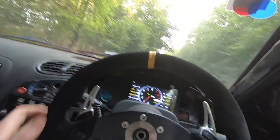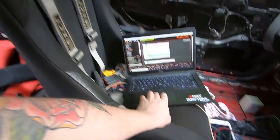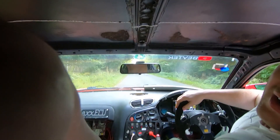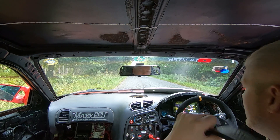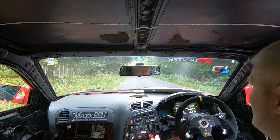Getting somewhere - I've got the car shifting fine as it should, up and down gears in different modes, and I've also got the drive logic button working. Drive logic mode is at zero just now, so if we go across here it's in three, and then I can put it all the way up to six for aggressive shifts and stuff like that. I'll get the camera set up and do a couple of those for you. Just now we're running wastegate pressure - 0.3 to 0.4 bar, so it's not super fast, but at least I can dial in the tune a little bit more and then start upping the boost when I start nailing it.